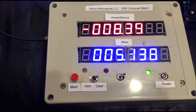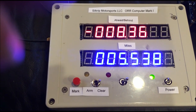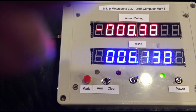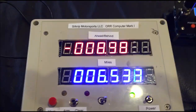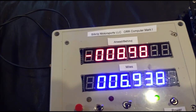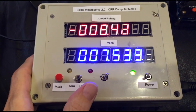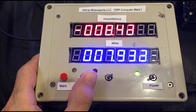I'm going to clear and get ready for the next waypoint. The next waypoint is at 9.4 miles — the county line sign — and this serves as a tire warm-up because the tires expand as they get hotter. We're going to run the first 9.4 miles and then do another red push button so that the computer starts off at 9.4 miles with the tires up to temperature and up to the right size.